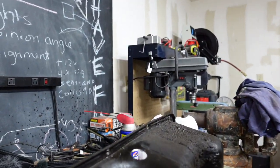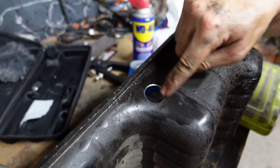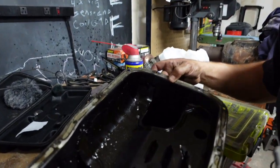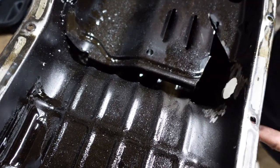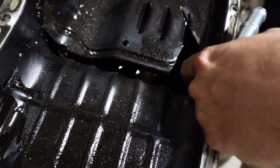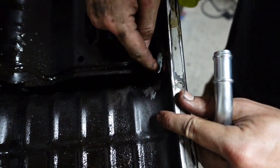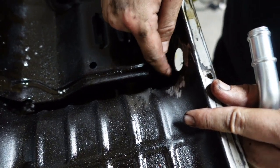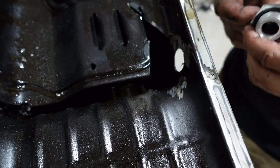After looking for like 20 minutes for Ronnie's step bit, we found it and put this hole here. I cut a piece of the baffle off inside and cleaned up the inside. You want the inside edge and the outside edge to be as flat as possible so it can seal good. We're going to clean up this edge — there's some metal hanging over. We'll take some sandpaper or a file to it and show y'all how this goes in in just a second.